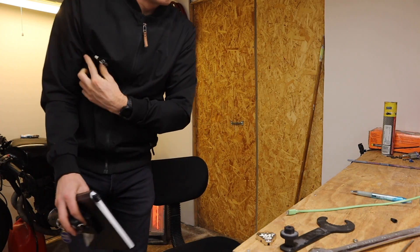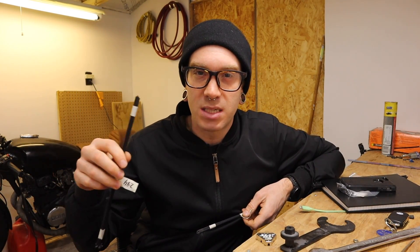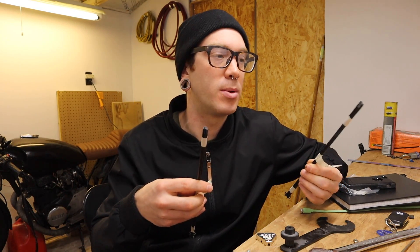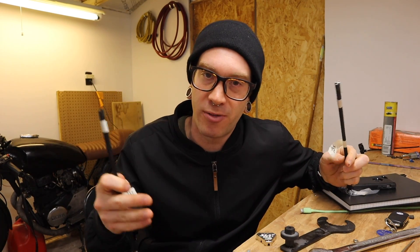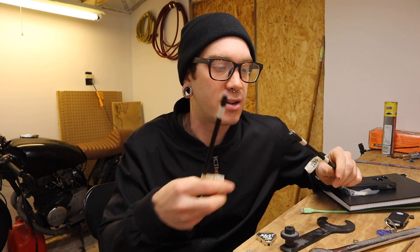It's 23 degrees in here. Back from the shop — Cycle Smith in town actually has a spoke roller, I forgot about that. So they were able to roll the spokes out for me, which is way better than just buying them out of the box, because then it's guaranteed to be perfect length each time since the person doing it has to actually check. So 285s and 284s — perfect.